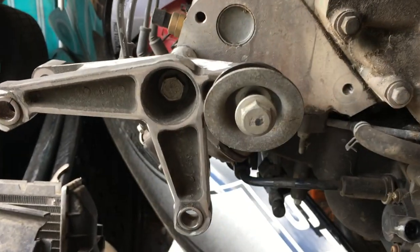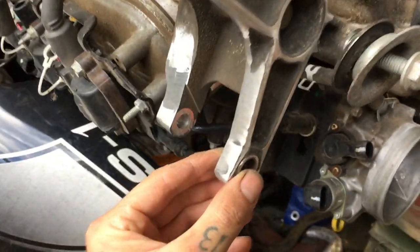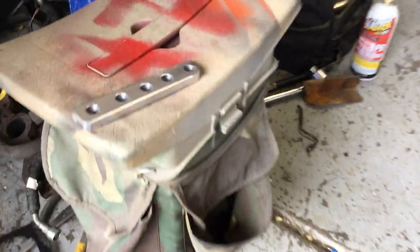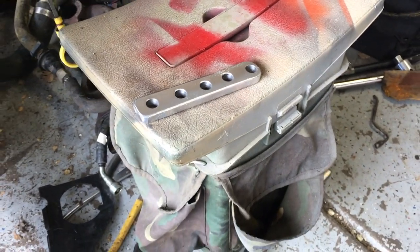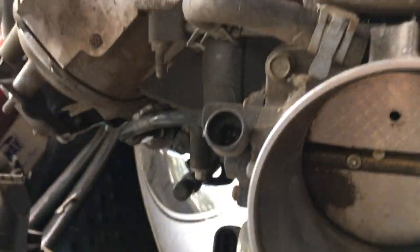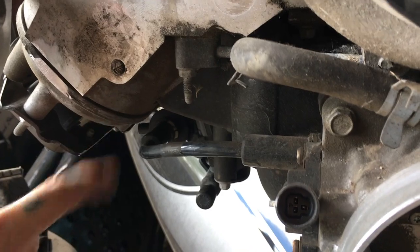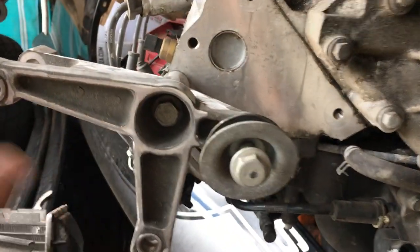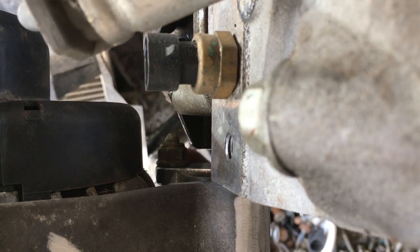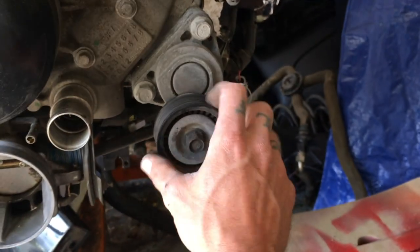For this to work, you literally just move the bracket for the alternator up to here. Take the shorter bolt, put it in here — it'll swivel — then get it as close as possible to the coil pack bracket without hitting, so you still have room for a nut and bolt, then notch this out to the thickness of your adapter plate. Thicker is better — aluminum or steel. I lightweighted mine because it's steel and painted it silver. That connects from right here on the top of the block next to the valve cover over to the part you notched. Now we have the bracket installed and the alternator is mounted. You can see the clearance between the coil bracket and the nut. I just need to get another ribbed pulley to go here and it's pretty much done.